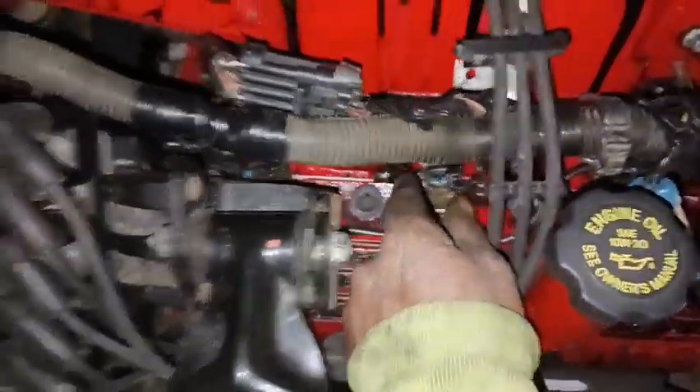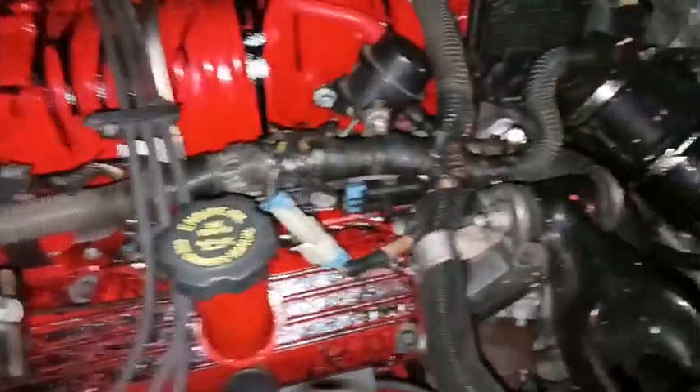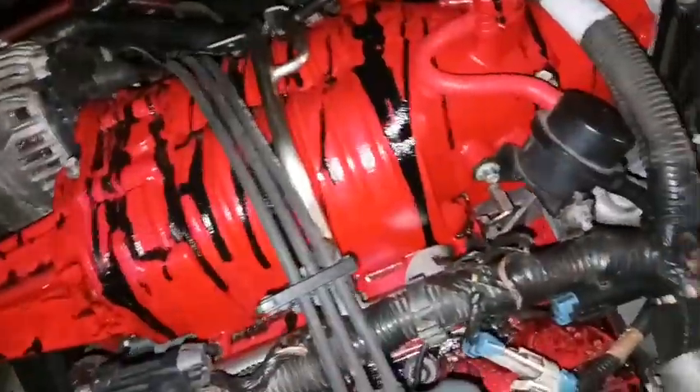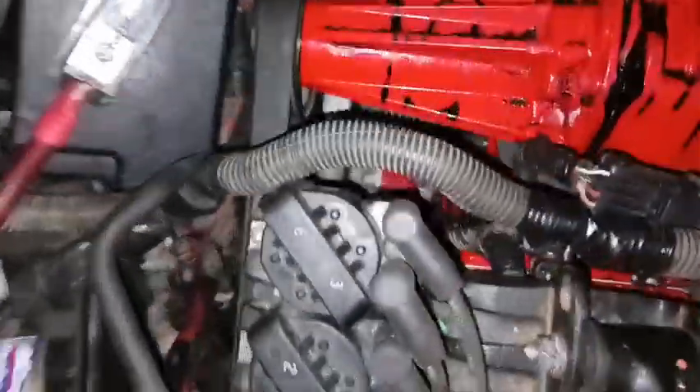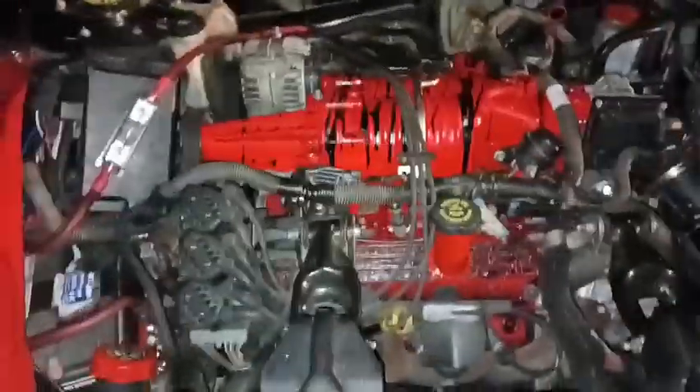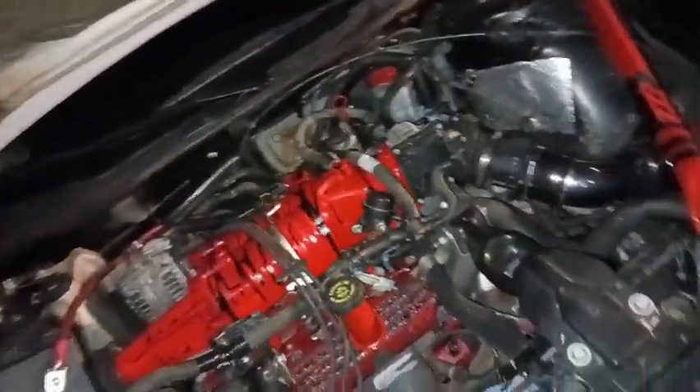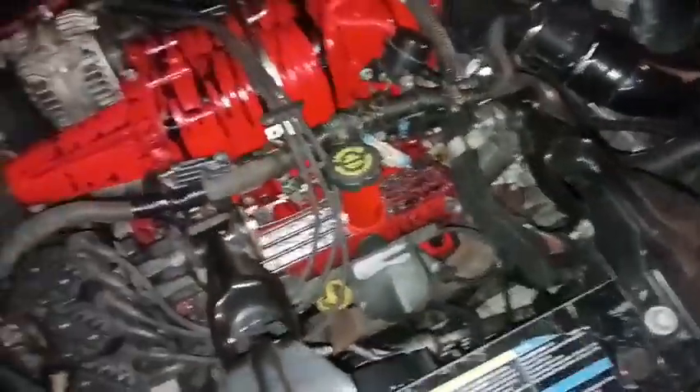It's the next day — Monday. On his way home yesterday the car was flashing the check engine light and misfiring. We decided to swap out the injectors to the factory L32 EV6 33-pound injectors, took all the new O-rings off the new ends and swapped those out. Also found a belt that fits the supercharger after trying four or five different ones. And I got another spark plug because one had broken — so now all six are NGK TR55 iridium. Let's see how good it runs.